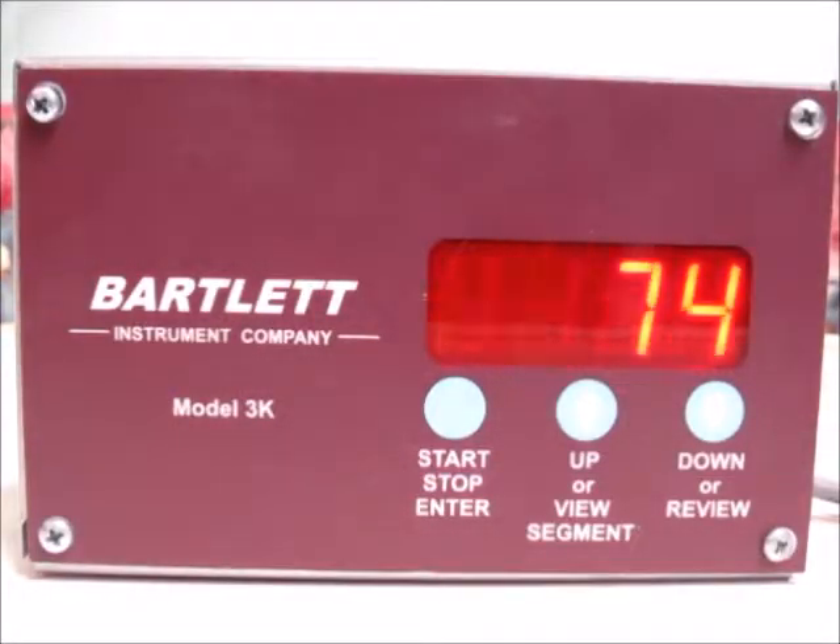Now we just need to make an observation of the temperature. What we're looking for is a room temperature reading, which we've got right now — that means the thermocouple has gone bad and just needs to be replaced. If you get a really high temperature or a strange temperature other than room temperature, that would indicate that the thermocouple circuit on the board itself has been damaged and needs to be repaired or replaced.